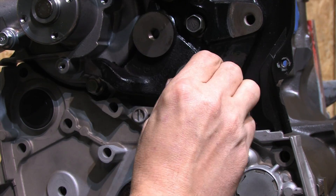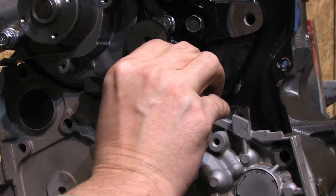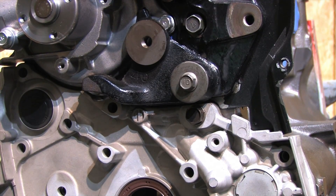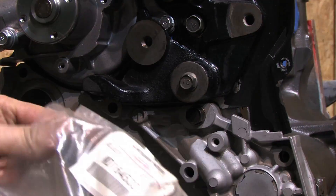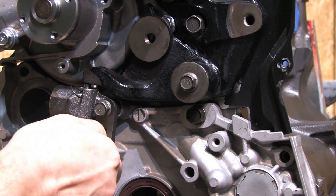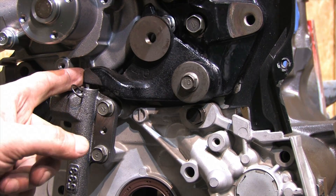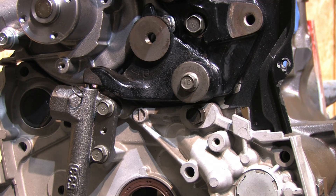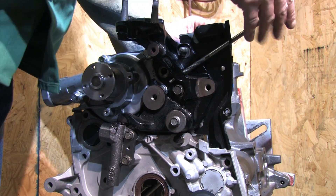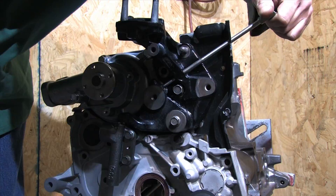That's the way it's supposed to fit. It doesn't have to travel very far — it just can't be rubbing on anything. If all of your parts are from the same generation, there's a timing tensioner adjustment tool that most people find very handy. It lets you compress and lock down the timing tensioner so you don't have to remove and re-compress the hydraulic tensioner when performing timing or valve train jobs. But it doesn't fit for a 1G and 2G swap — the timing tensioner tool hits a water pump bolt instead of the 1G tensioner arm. So far, everything is the water pump's fault.